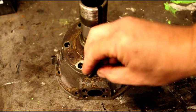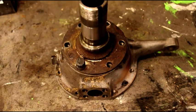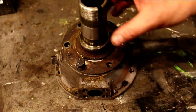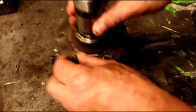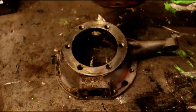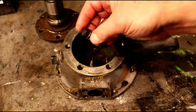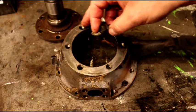This area can be quite troublesome for some people. It is very easy to rip everything from this point out, and it will come right off the hub. This is a 3/8-24 fine thread bolt. From the factory it was a grade 5. When I do these I upgrade to a grade 8.